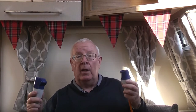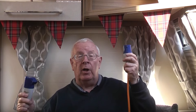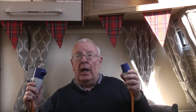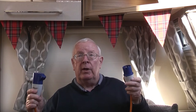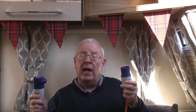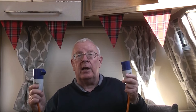To do that you're going to need one of these — a mains electrical feed cable. One end goes into the caravan, one end goes into the electrical bollard that will be close by your pitch. It's very important to get a really good quality cable because it has to safely carry the power to your caravan, and it's going to spend a lot of time outdoors in all weathers.